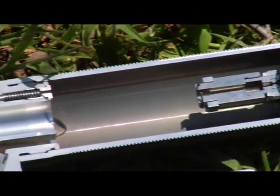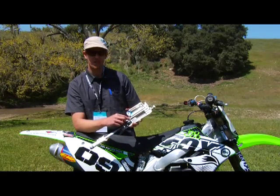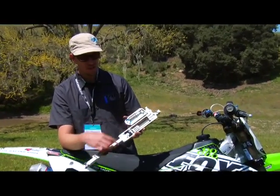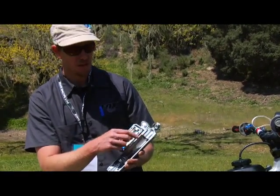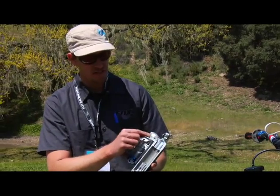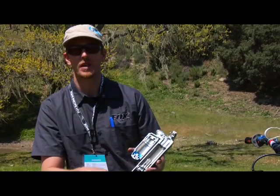Here's a cutaway of the RC3. Up at the top is the bottom-out adjust circuit. What you see is this would be the regular compression and rebound valving like any other shock, and then on top is an extension with the small piston. Deep into travel, this piston goes into a cup in the body cap. That traps oil and creates extra damping. The flow of that oil is regulated through this passage by this needle. So when it's closed off, it's maximum bottom-out control. When the needle's open, it's minimum bottom-out control.